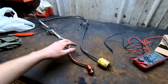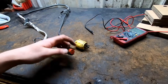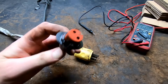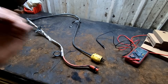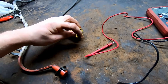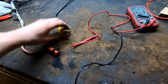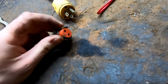I was able to pull the whole cord right off the truck to make it easier to check for any breaks in it. Now I can check with my ohm meter on individual wires in this cord to see if they are broken, or if it's the block heater itself. This end is where it plugs into the block heater - the block heater is still in the truck. Keep in mind that since the block heater is not plugged in, going from one end to the other won't be a closed circuit because the block heater is what completes the circuit. So we have to test the wires individually.